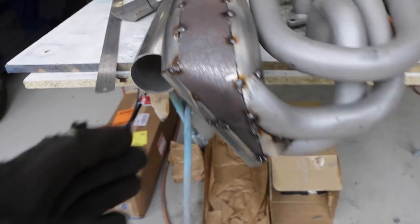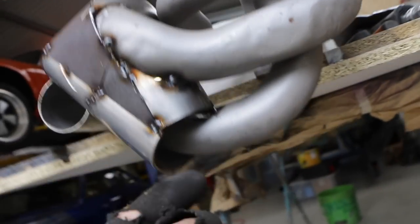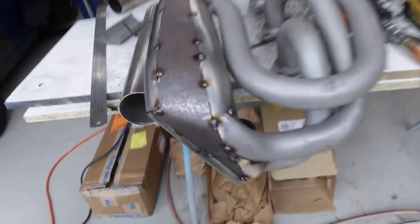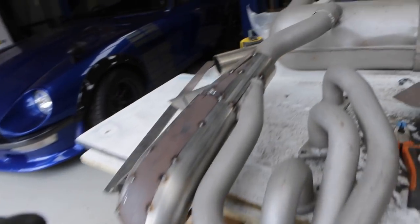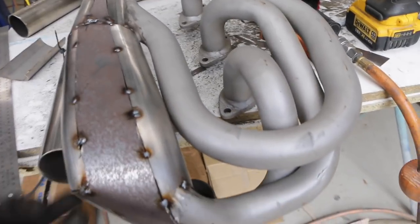That's really coming together now — you can see it's all wrapped around and joins around here. I have to add the pipe that goes up off of this, which will actually be the bit that connects onto the pipe that goes into the car. On the front, I need to flip this over now because I'm close enough that I can actually MIG weld everything up. I need to flip it over so I can do the top half.